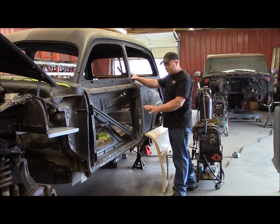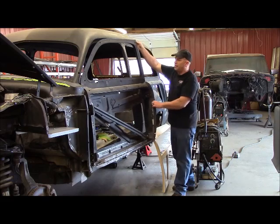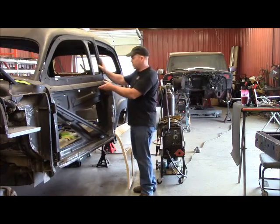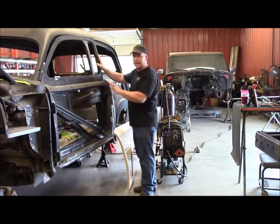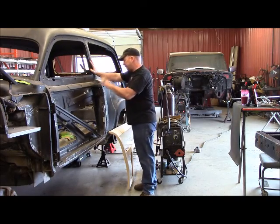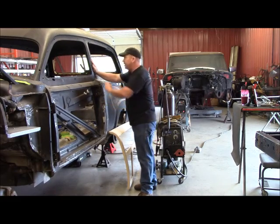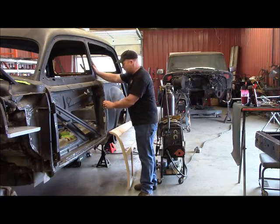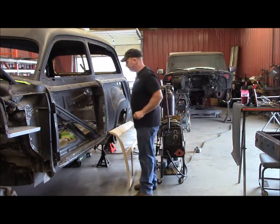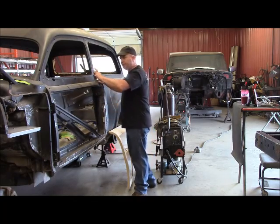Now when I was building your door, I didn't completely finish it up. I got this piece tacked in. I've got some more welding to do on this, and I never did hook the top of these. They're both sides broken. Top just flops. And then I can get this door where the seal and the door frame fit that pocket in the best location. So I'll get all this metal work done, get this thing latching, striking, closing far enough to where that seal fits real nice all the way around, and then that's going to determine the depth of my door wood in relationship to the depth of this, and then I'll plane them both down together.